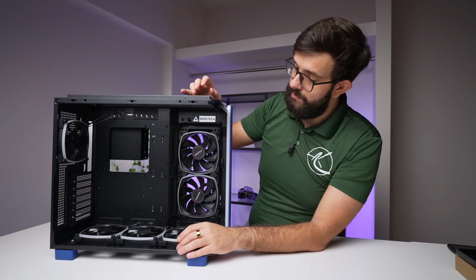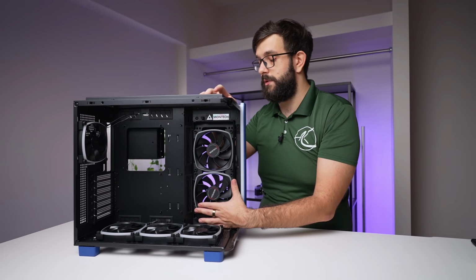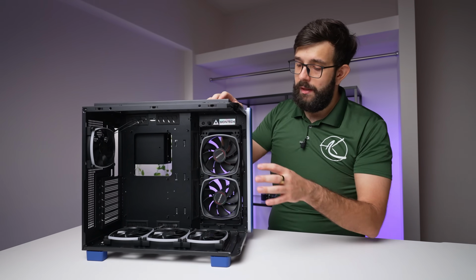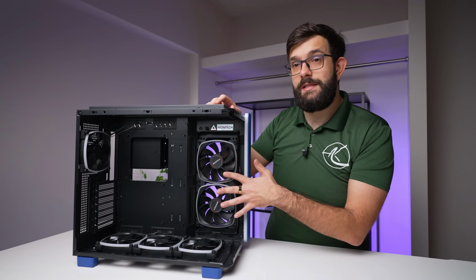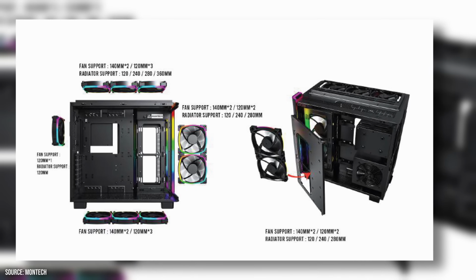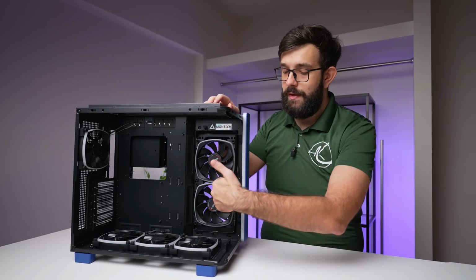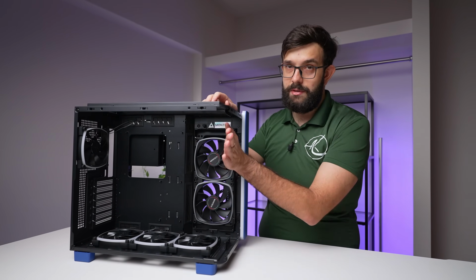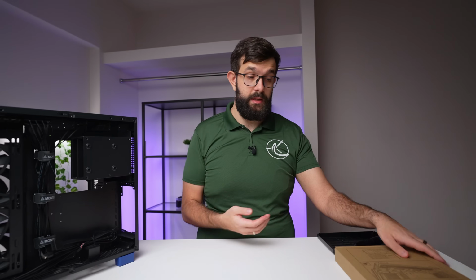As far as the radiators are concerned, you can also install a, well, 240 or 280 here as well if you wanted to. I would go with 280, but a few things to consider. You can have a maximum of 65mm clearance with the radiator over here, so it doesn't interfere with the card. And if you have that, you do still have restrictions. At the same time, if you were to turn this across and have fans here, you have restrictions for the card as well.